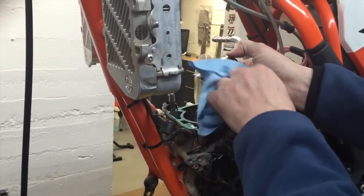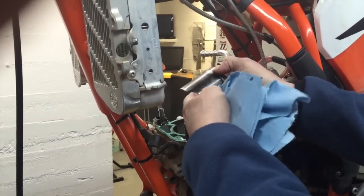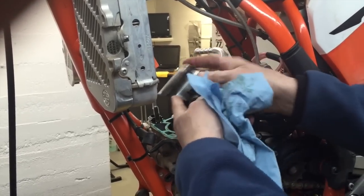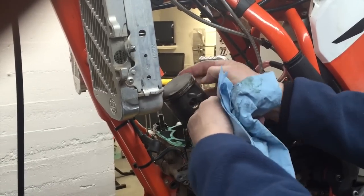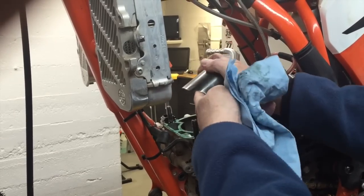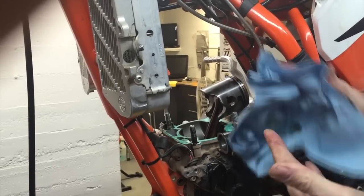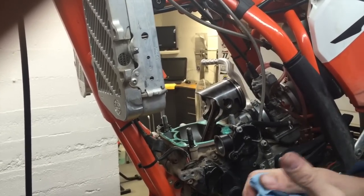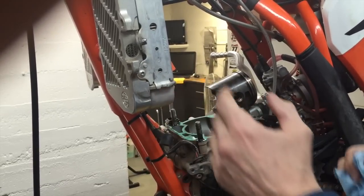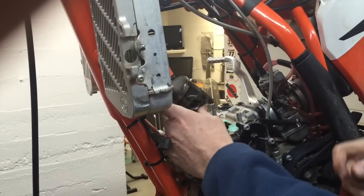And this piston's got about 85 hours on it with AMSOIL at between 80 and 100 to 1. The AMSOIL Sabre. And this piston's in excellent shape. It actually doesn't need to be replaced. But I like to keep my engines really fresh. And so every 80 or 90 hours, somewhere in that range, I usually change out the piston because I can feel them falling off the power just a little bit, and I want my motors nice and tight and fresh. So this is in excellent shape.